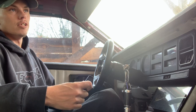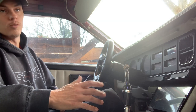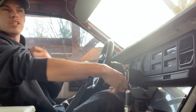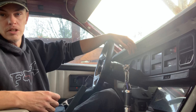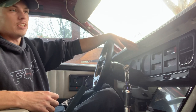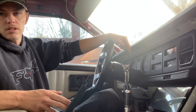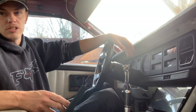It took me a few minutes to figure out the XDFs. The first time I tried to turn off the VATS the car wouldn't even start — I did something wrong, I can't remember what it was. I was a little worried because I heard you can brick your PCM — some people have messed up trying to write their own computer. But it's not very likely. I had no clue what I was doing and messed up once, but this new version 2.2b of LS Droid is pretty much... well, I shouldn't say impossible, but it'll stop you — it'll tell you if you're doing something wrong or if your checksums are invalid or stuff doesn't match up right.